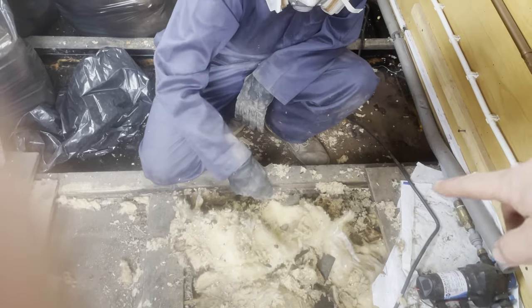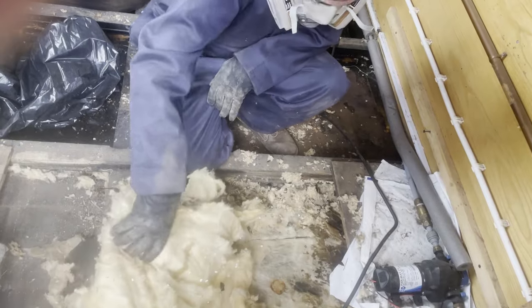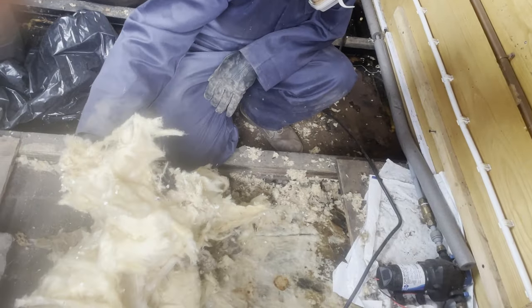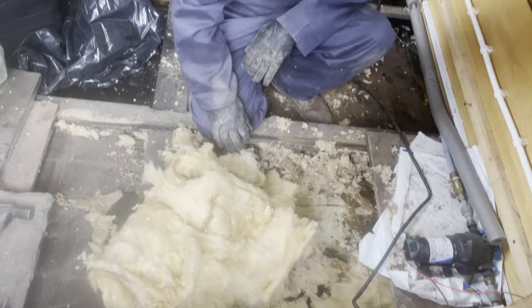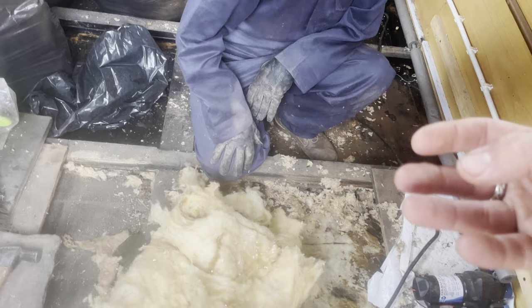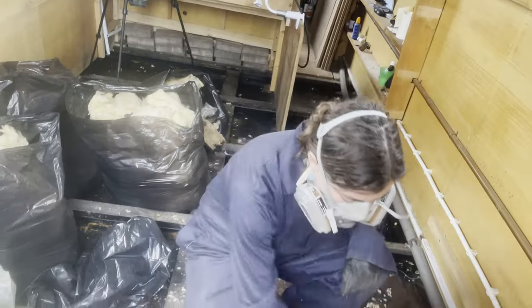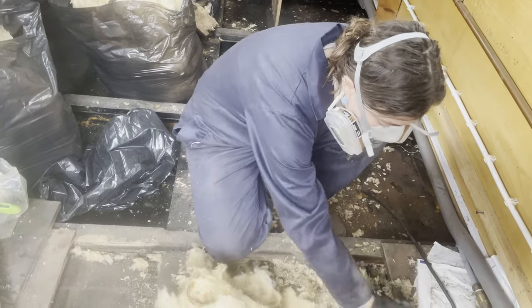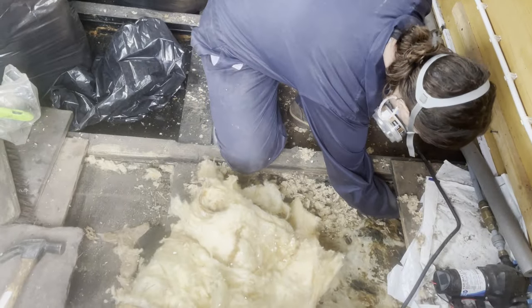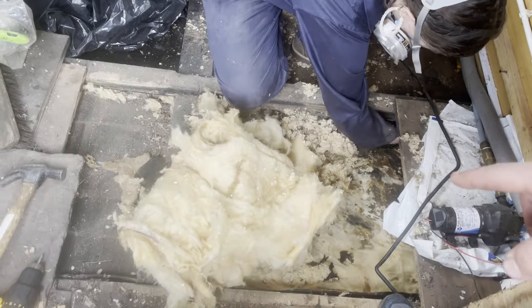What we've found is some nice mice nests. And this is wet under here - wet underneath there. The main reason for not using this sort of fibreglass insulation is for this very reason: once it gets wet it soaks and sponges. This isn't too bad, but the stuff from the back of the boat was mouldy. You can see - I think that might be from water pump leaks.